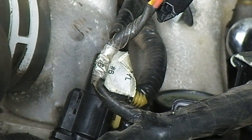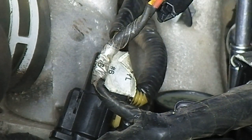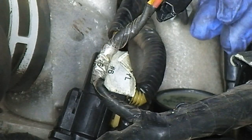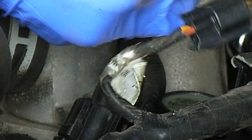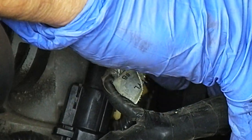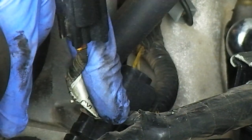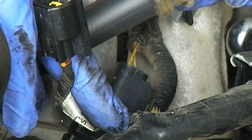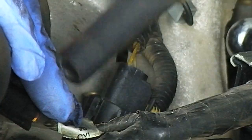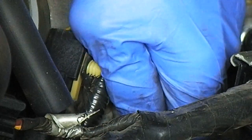I'm going to need a 7mm socket to take this little screw out of here. That's all that holds that coil assembly down — just the screw. Then you just carefully work these off. I don't have to be too careful because this is the piece I'm going to be replacing. I replace the whole assembly, especially after they've got 100,000 miles, because they cause misfires that come and go — and it ruins the catalytic converter. Down in the hole below it is of course the spark plug.